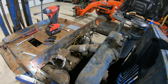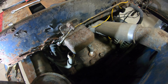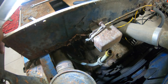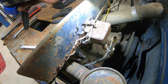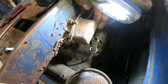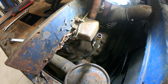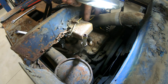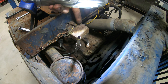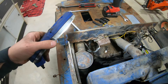Now that we've got the fuel tank out of the way, we can take a look at this terrible wiring job. It does look like it's externally regulated. I believe this was done a long time ago because you can just tell by how old the regulator looks. It's only mounted on the top side — I can actually flex this up and down. There's a tab on the bottom where you can mount it as well, but somebody only screwed it into the top hole. So I'm going to say this was done with the 12-volt conversion. We should be able to keep this regulator and alternator as-is. I'm just going to end up rewiring it all.